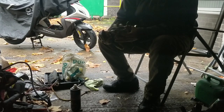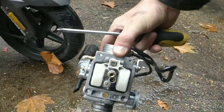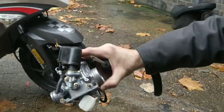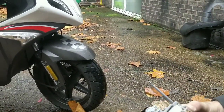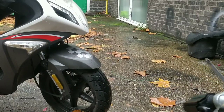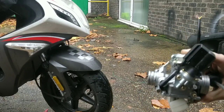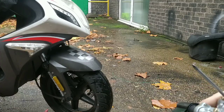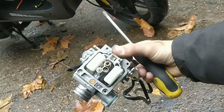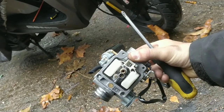I've definitely found our issue - this is brilliant guys! What's missing? It's very dark. So you saw me just take the bowl off - the main jet is missing! What has happened there? Something snapped. Where has that come from and where is the main jet? Blimey, I've never - that is unbelievable! The main jet that sits on the top has somehow sheared and busted off. I've never had this carb open, remember. It is gone.